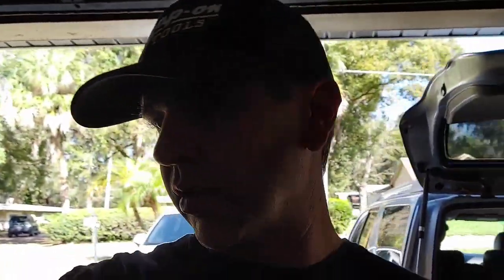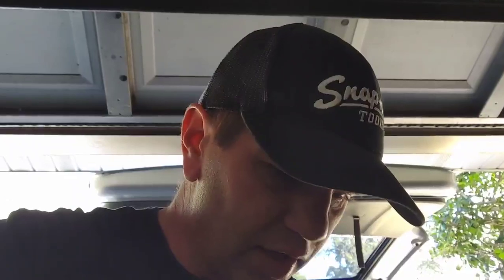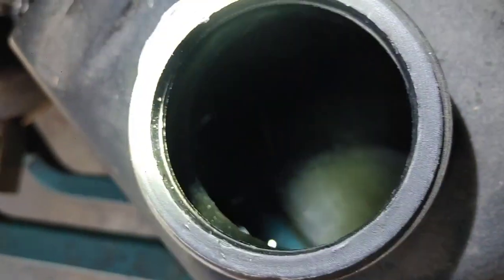A lot of times when you're messing with these old mowers you'll find multiple issues - I was finding all kinds of things: wires not connected right, not grounded right, had some wires just twisted together so I soldered those. I've made videos on soldering wires too - that comes in pretty handy. But this video is mainly about using that leak down tester to figure out the issue, diagnose it, and get the problem solved. This thing ran out of gas right when I went to crank it up for you guys - I must have burned half a tank letting it run the other day to verify the head gasket.